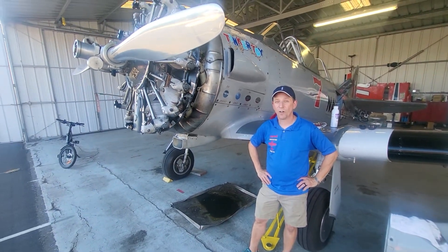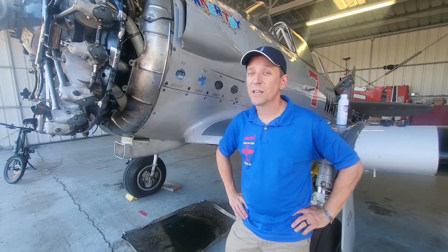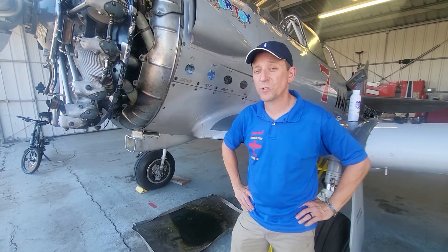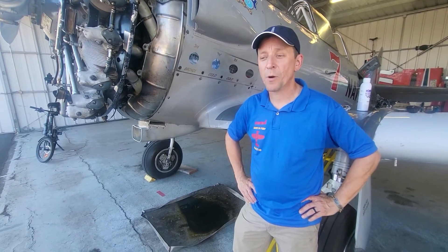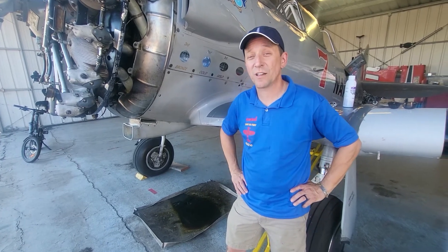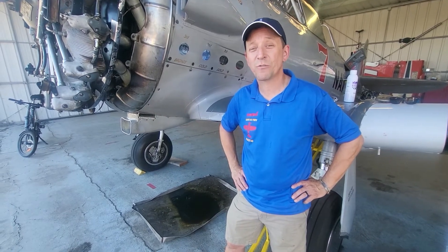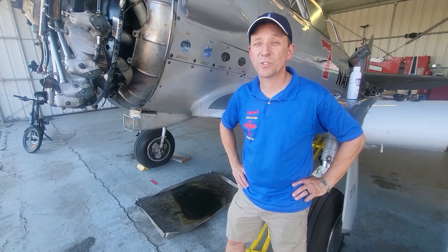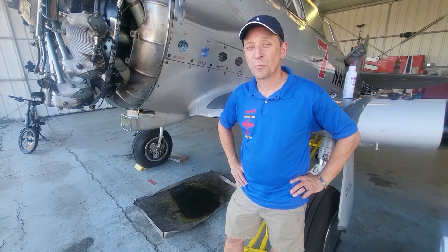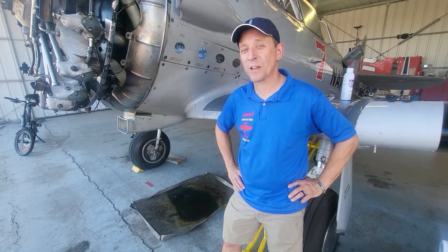As a quick aside: we normally race at Reno at 5,000 feet, so you get maybe 37 inches of manifold pressure, which is just above the T6's official takeoff power of 36 inches. But we were racing in Phoenix, Arizona at nearly sea level, and guys were seeing 42 to 44 — even 45 inches of manifold pressure. They started roasting the engines. Everybody thought it was the oil from the new sponsor, but I was never sure because we were just running so much more manifold pressure than we normally do.